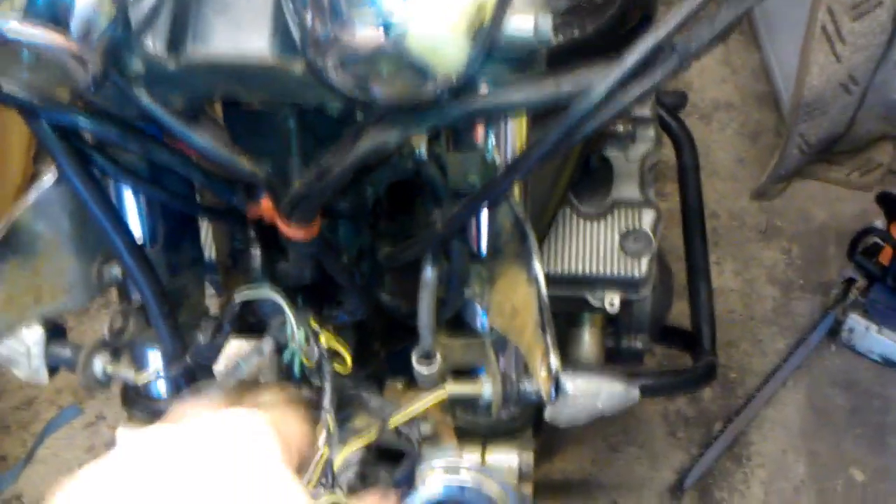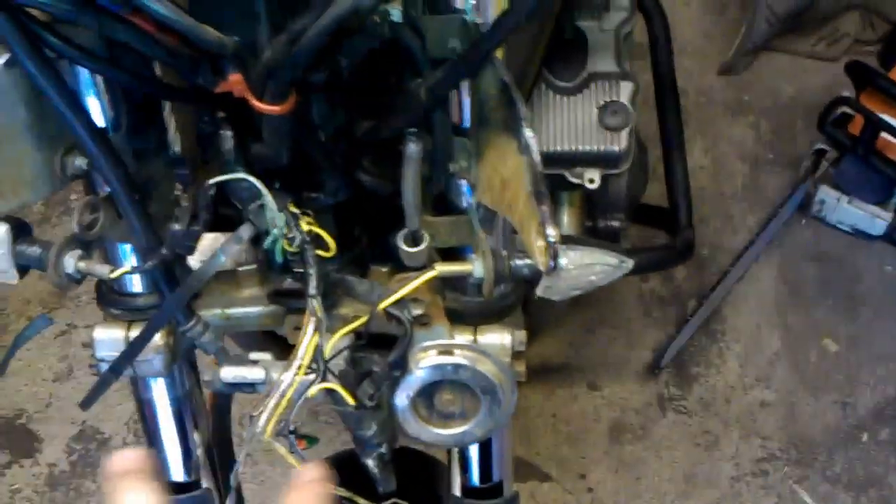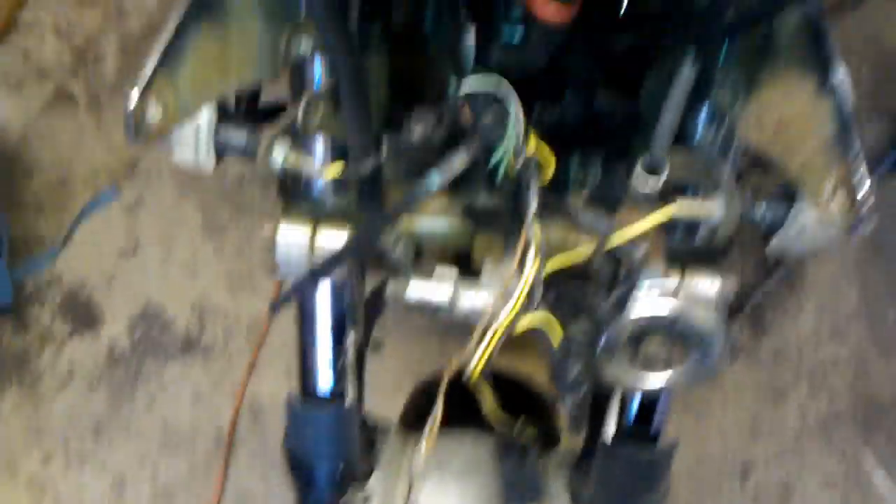From those two outputs I'll split those off into two, so I won't just stick it in one light then the other. I'll have one thick gauge cable — I'm talking thick 17-amp cable — and then split that off on a piggyback connector to the two lights. I'll still piggyback the sidelights because they don't use much wattage, so they'll be fine, especially as I'm using LEDs now. Then I'll run the earths back to the battery, so it's all done off this switch.